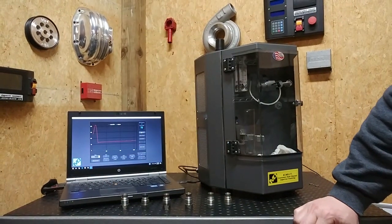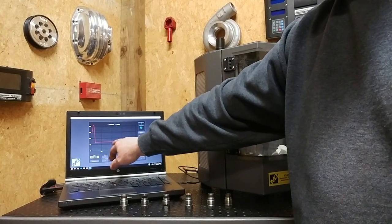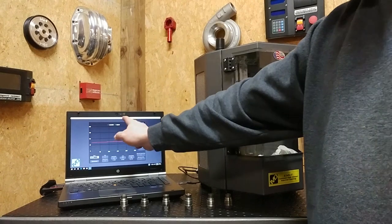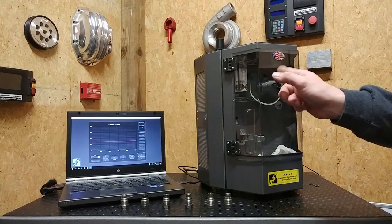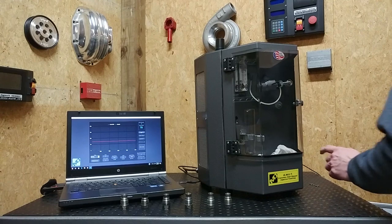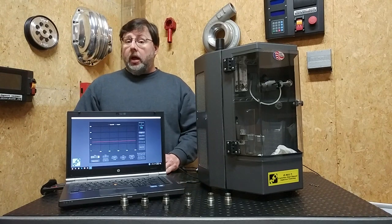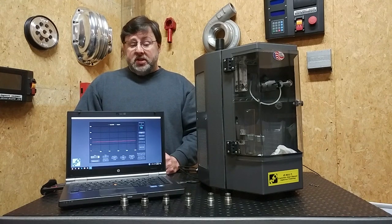Turn the scope back on. So that's what happens — until the rail pressure drops. Like if you're running wide open and this valve blows open, your rail pressure is going to drop to here and it's going to stay there until you jump off of the throttle, let the pressure drop below this point, and let this valve reseat and take off again. For some guys, they get pressure oscillations — the pressure's up and down, up and down, because ultimately it's going to drop below that point and reseat and take off again.